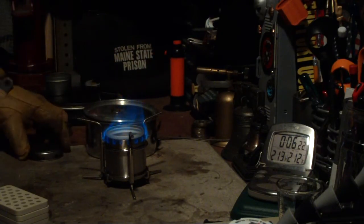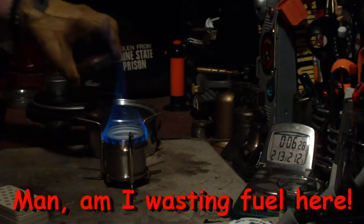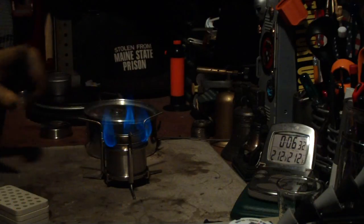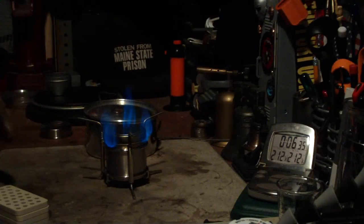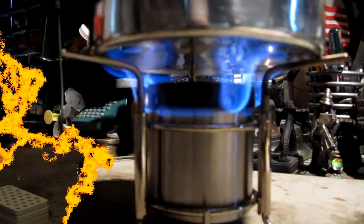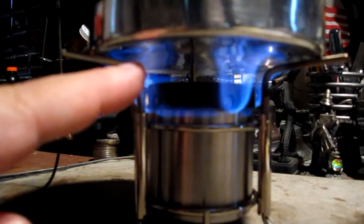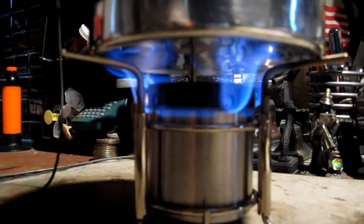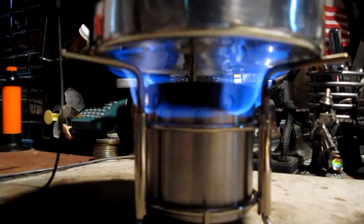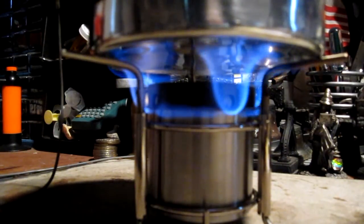Let me take this off and try to put this simmer lid on. Line it up with the holes — there we go. I've actually got 6 flames coming through there. So this is what the simmer looks like. It does look like it's leaking out underneath the lid a bit — maybe I have to put some weight on this. That hole I put in the middle on top — I don't really see a flame coming through that. But I am getting a little leakage. So that's 5 of the main jets, and then just a little leakage.